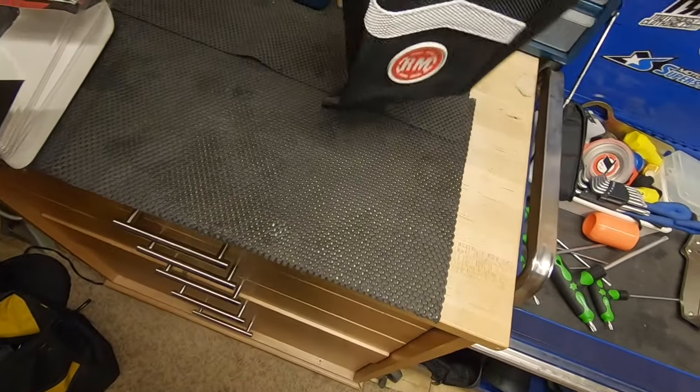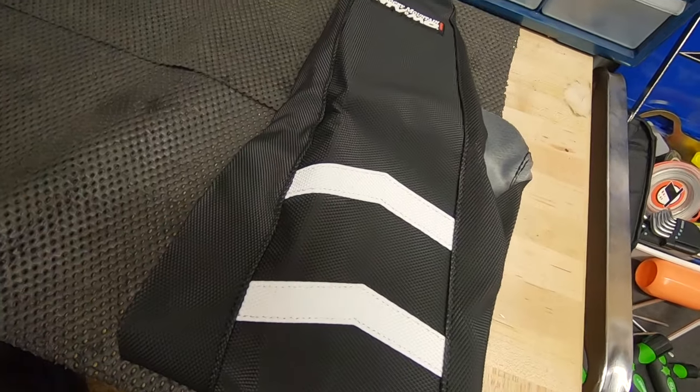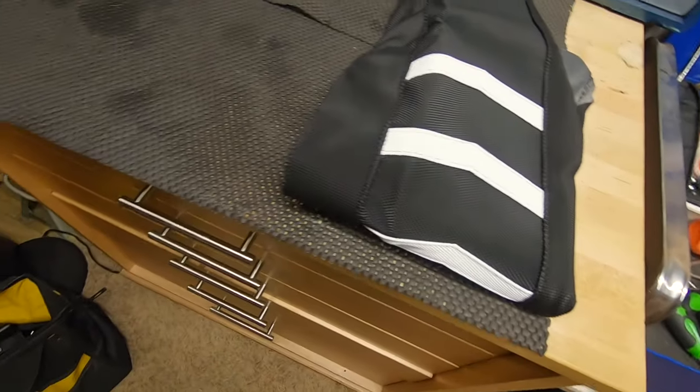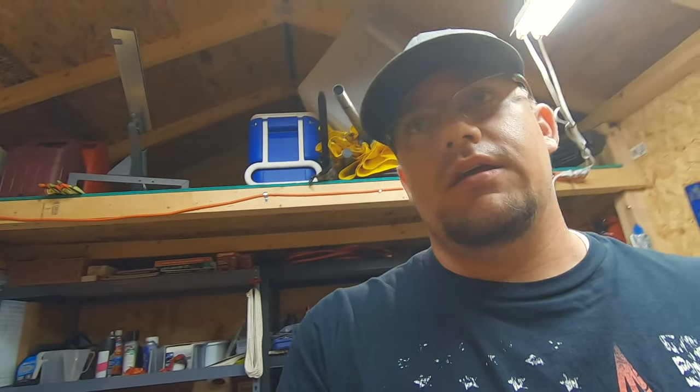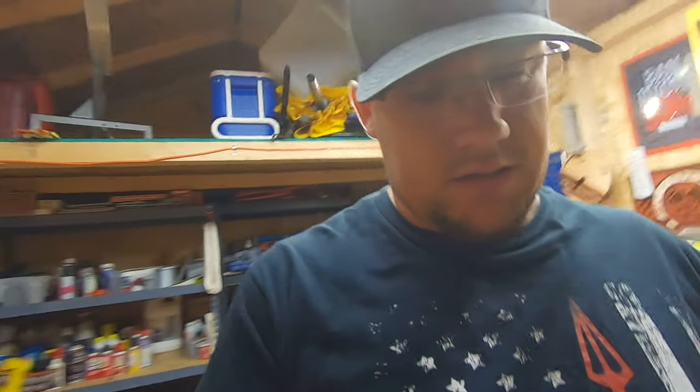I'm going to show you guys how I go about doing a seat cover install. It's pretty simple — really just take out a bunch of staples, put in a bunch of staples. First we're going to remove the rear seat, which is just that 10 millimeter bolt, pop it off. If you have a staple gun — it doesn't have to be pneumatic, a handheld staple gun works — and needle nose pliers to pull the old one out, you pretty much have everything you need. It's super simple, super easy.